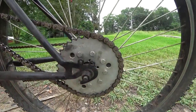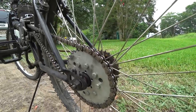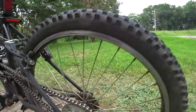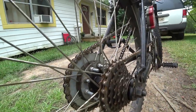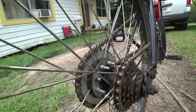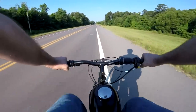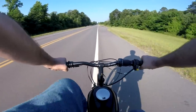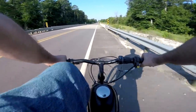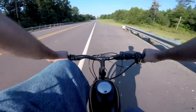In this section of the video I'm not here to help you choose what size of sprocket to go with, as that is based on personal preference, riding habits, the style of bike, the terrain, and your weight. But if you're willing to give up some sacrifices in the low end pedaling department, going smaller on the rear sprocket has a number of benefits which might appeal to a lot of people. Something important to keep in mind is that the benefits we're going to be discussing about going smaller on the rear sprocket intertwine into two categories of riders — an important distinction because it's going to affect your purchasing decision and how you might decide to ride the bike.